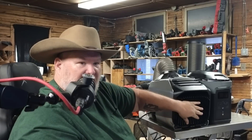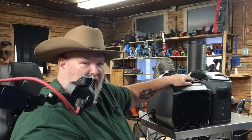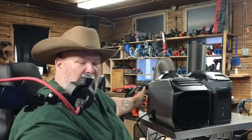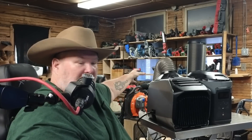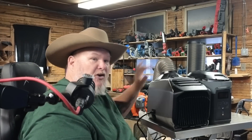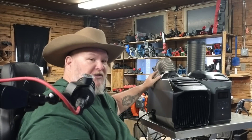If you're using it inside, this side is for your inside air. The conditioned air, whether it's hot or cold, you'll want a hose going out so it takes outside air, pulls it in, and then the waste air goes back outside. You don't want that to stay in the same room or it will nullify what you're trying to do.